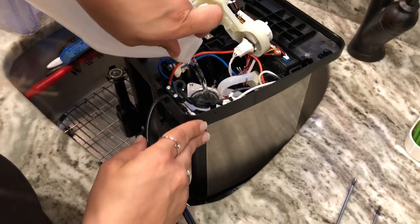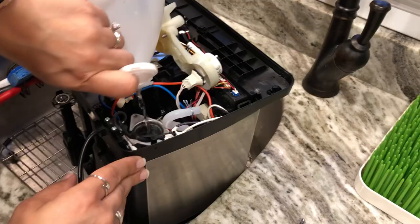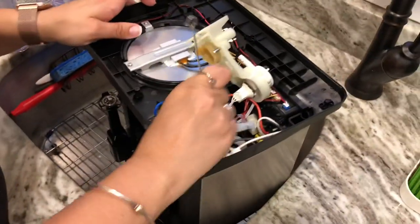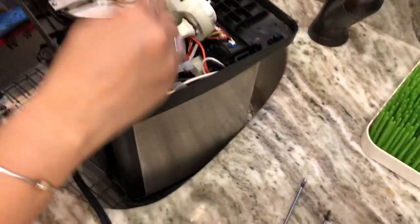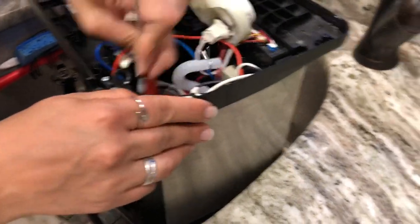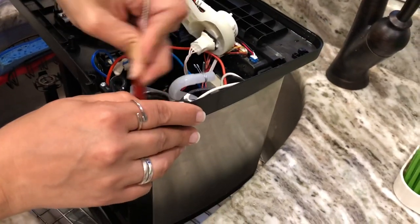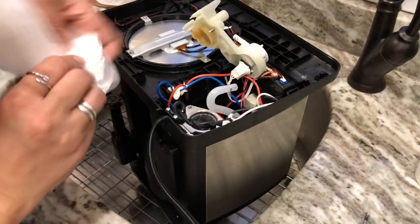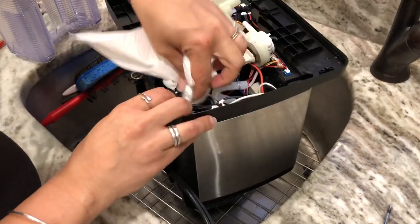The vinegar is so acidic it's actually eating up most of the hard deposits. Then I'm going to go ahead and take my little straw cleaner and get in there a little better. Clean it up with a paper towel. Once you're satisfied with getting most of it out, you're going to want to put it back together and do a few clean cycles — about ten or so — and after that it will be working like new and back in action. Thanks for watching.